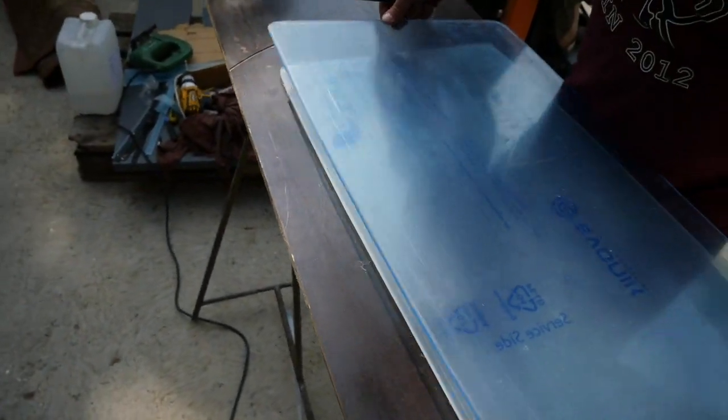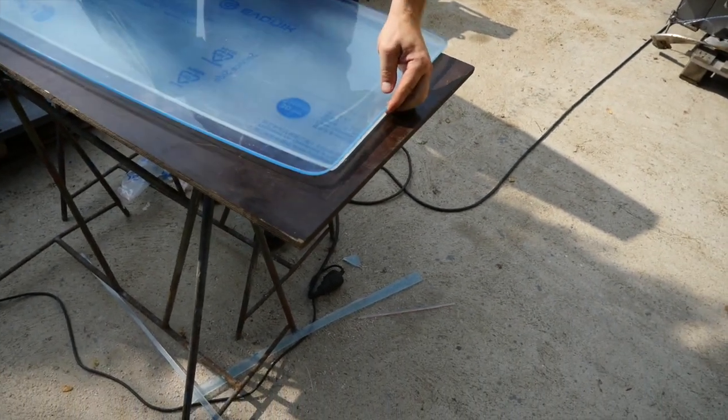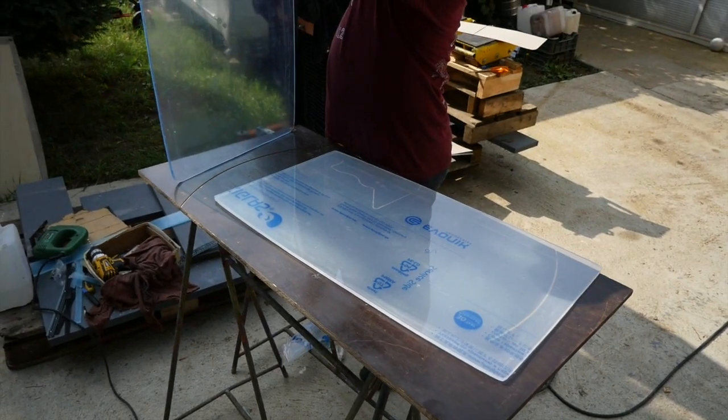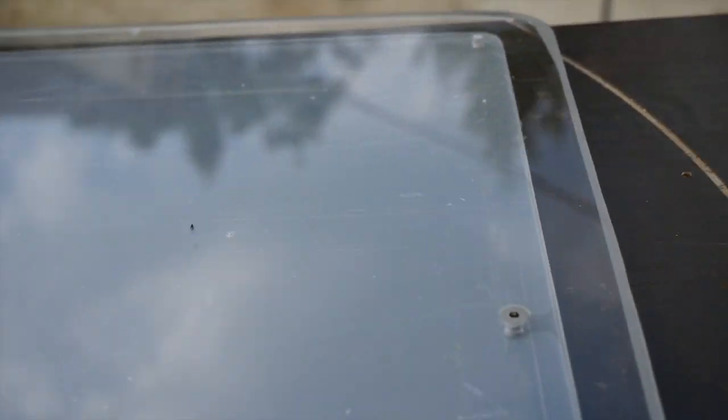Here we are now working on the smaller piece on the inside, so we put the big piece that we knew was fitting quite well down, and then we marked very carefully where we wanted the two of them to be joined up, and then we tapped a few holes with a tap drill, and then Gabor even made a bit of a sink-in for the heads of the screws so that they would fit really flush with the edge of the plexiglass and not stick out. And that not only pulled them very tightly together, but it made it look very smooth.